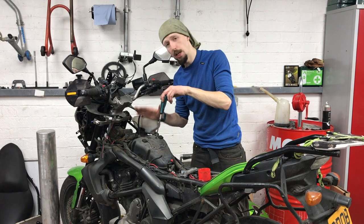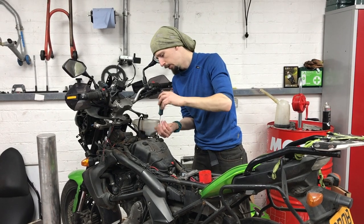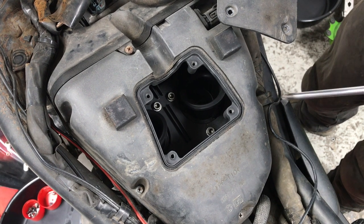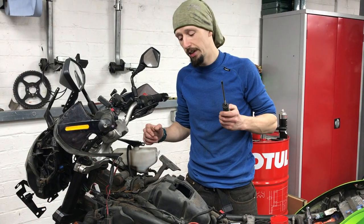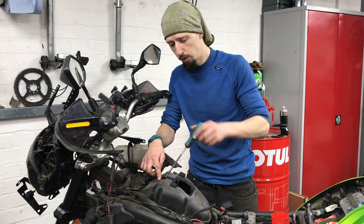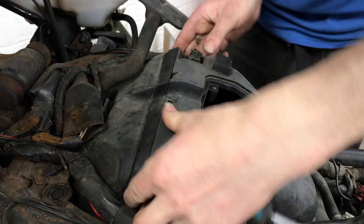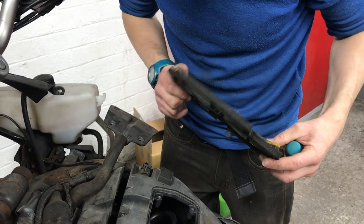With the tank off, we then need to get the airbox off. There are four screws on the top which get you on the inside, to then reveal another four bolts to be removed. There are these four here which I think is possibly a 5mm Allen — and you can see right down into the port, so don't be dropping anything down there because you're going to ruin your engine. It's also worth mentioning at this point you can have a little eyeball at your air filter, which is just here. You've got the one screw that attaches it in place, because if you've gone all this way you might as well give it a look. So yeah, that could probably do with a little bit of a clean but easy now that we're here.